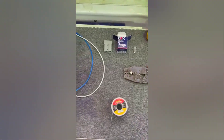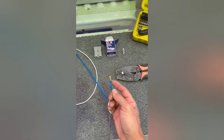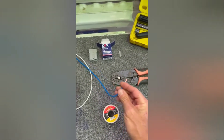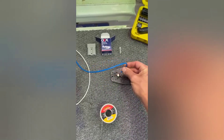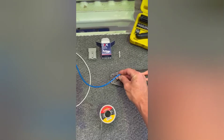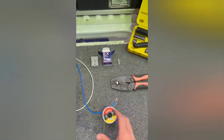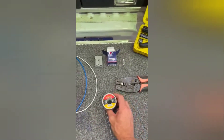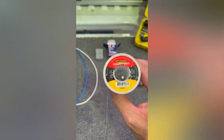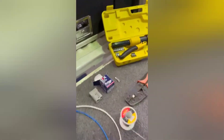This is even better when you're using small wiring. This is 5mm — I'm just running in an Anderson plug for a little fridge. Crimping that, you'd have to crimp it down virtually flat, which is just going to fracture and weaken that join. So the best and easiest way — anyone can do this — is get yourself a little blowtorch and some solder: 1mm diameter with 2% flux.